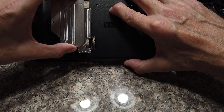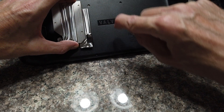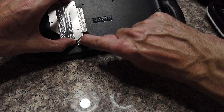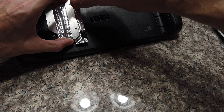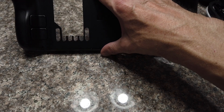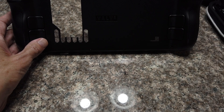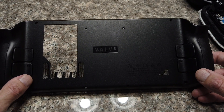After that hole is drilled out, you can place this on top and trace the outline. Keep in mind this part fits underneath the case, so the hole needs to be marked straight down and not include the side flanges. Installation is totally reversible since you can get brand new rear covers from Valve and reinstall all the original components.